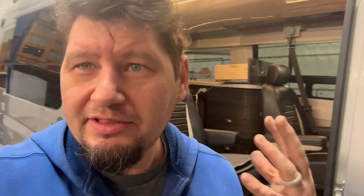As far as alternator concerns go, these Mercedes Sprinter vans are designed to have two big AGM batteries in the back which can suck up a lot of amps, especially when deeply discharged — pretty much the same as lithium would take. Before the video ends, I want to discharge the batteries, start the engine, measure the amp load, and make sure it's within specifications. I'm going to add a 120 amp automatic resetting thermal breaker for systems like this — it will also protect the system. If we're pushing over 120 amps when batteries are extremely deeply discharged, that will disconnect in addition to the Cyrix CT doing its job. Multiple layers of protection — let's do it safe, let's do it right.